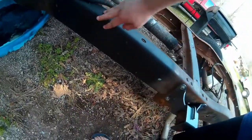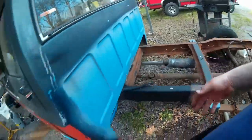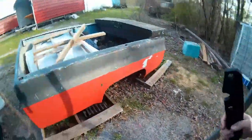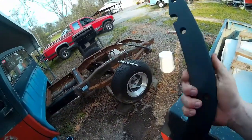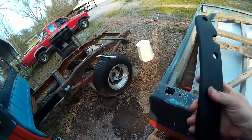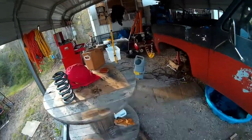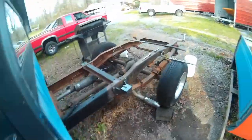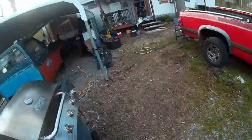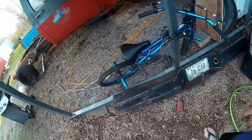I've got a section here that I did — you can see it's this nice matte black. This is that rust reformer spray. It's supposed to take a minor rusty surface, turn it into something that's protected and paintable, keep it from going any further. I took the bumper off the back already, and this is one of the mounting brackets — I've cleaned it up, there's still some pitting but I painted it with rust reformer, two coats. As far as the bumper itself, it is bent. I would really like to have a chrome bumper, so I may just replace it.